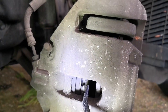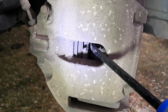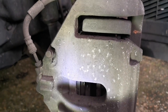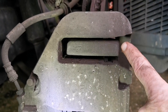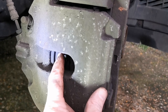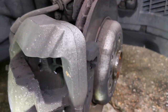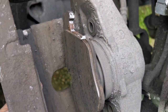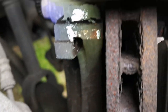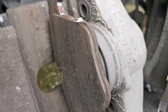After taking the two sliding bolts out with the allen key, I put a pry bar in between the disc and the pad and prised the piston back into the caliper with a little bit of pressure — try not to damage the disc. You then need to slide the whole caliper over so it pushes past and the caliper comes forward. One pad is left in the piston and the other on the bracket — they've worn right down and need changing, hence the warning light. Nicely, they've worn evenly, which is a good sign the caliper isn't binding.